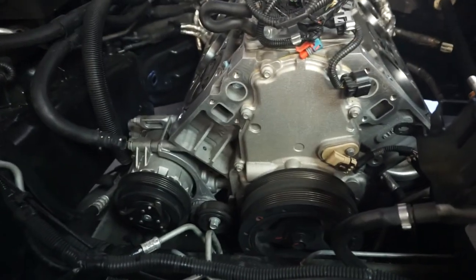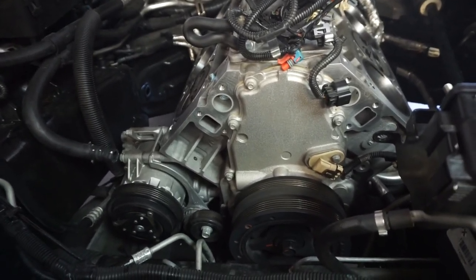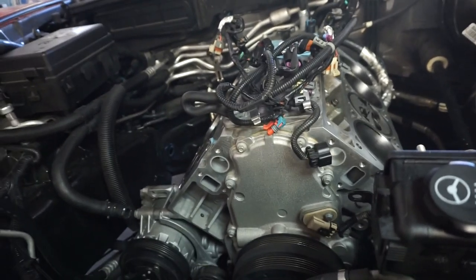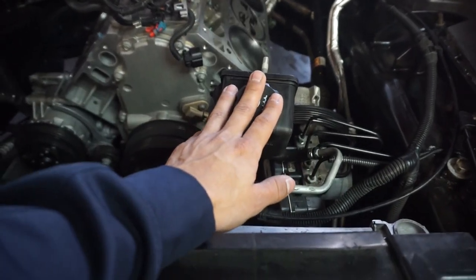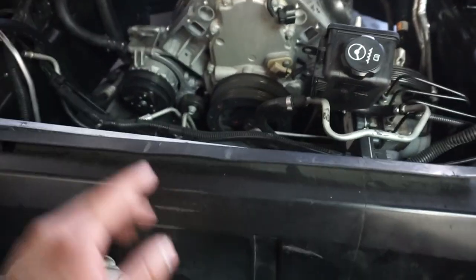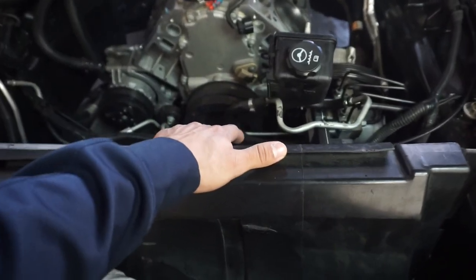These things are really easy to do when the motor is out of the car. However, when the motor is in the car, there's a bunch of stuff in the way. If you're just doing a cam swap on your motor, you're probably going to have to take off stuff. For a C6 Z06 — I think it's probably the same for a C6 base and Grand Sport — you're going to have to remove your power steering, the whole intake system, the whole radiator system. I highly recommend removing the condenser if you have a way of evacuating the system, because this is a huge pain to take out without the condenser.